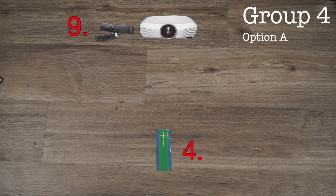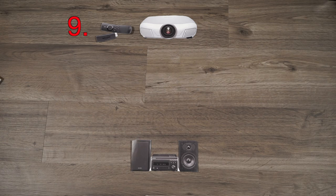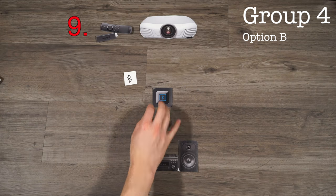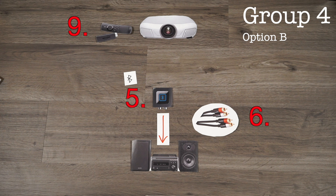Now, I understand that these tiny Bluetooth speakers might not be ideal, and this is why the final form of my system looks something like this. The Amazon Fire TV plugged into the projector, transmitting audio while simultaneously giving video to the projector, transmitting its Bluetooth to a Bluetooth receiver, which is then connected via dual RCA to my stereo system. In this way, I have no cables running from the back of the room to the front, and I still get perfectly in sync, clean audio through big speakers at the front of my room. I think this is the cleanest setup, and it's the one I currently use in my system.